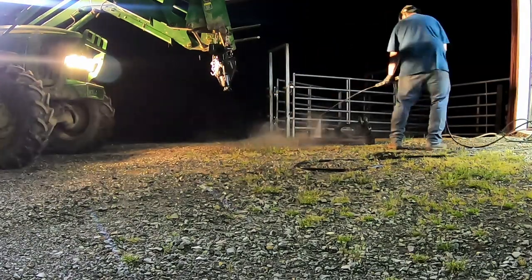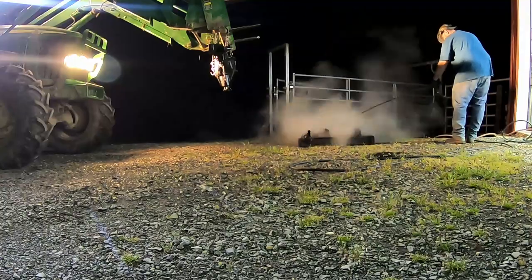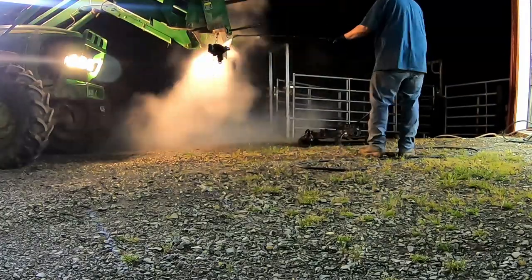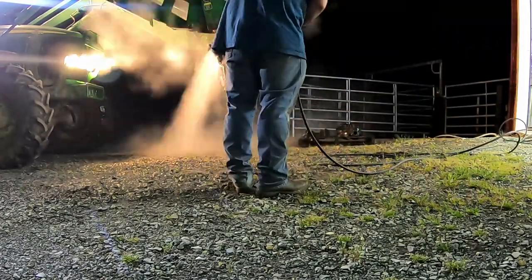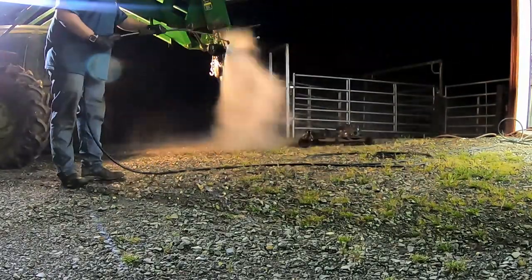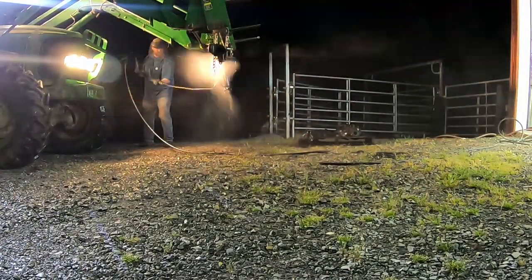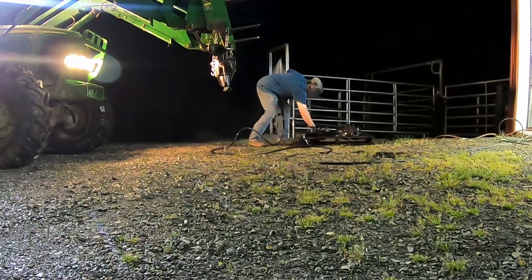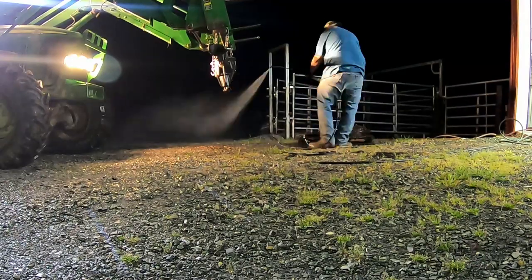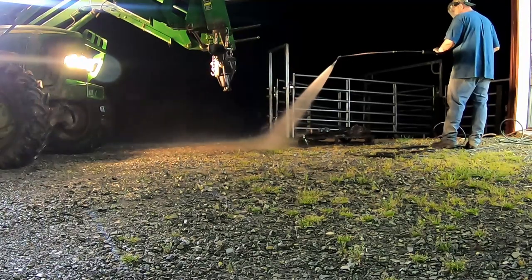I've got all my disassembled parts out here and I'm going to hit everything with a hot water pressure washer — caliper brackets, dust shields, spindles, and the main axle housing. I didn't have my axles out there initially, I did them later. Now, I didn't notice at the time, but after filming the shot of me putting the rag in the axle tube, I pulled it out of that side, shoved it in the short side, and forgot to put one back in the long side. So I ruined most of the bearings in my carrier — but no big deal, I was planning on replacing all of those anyway.